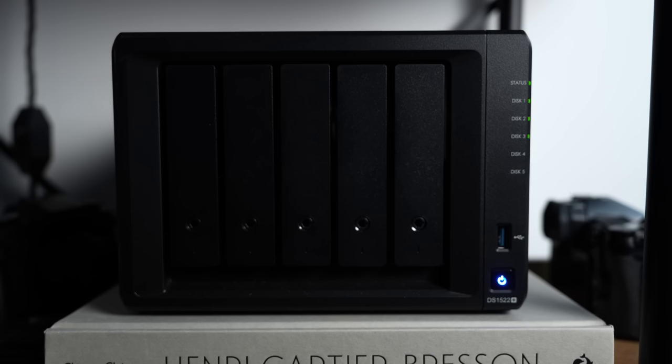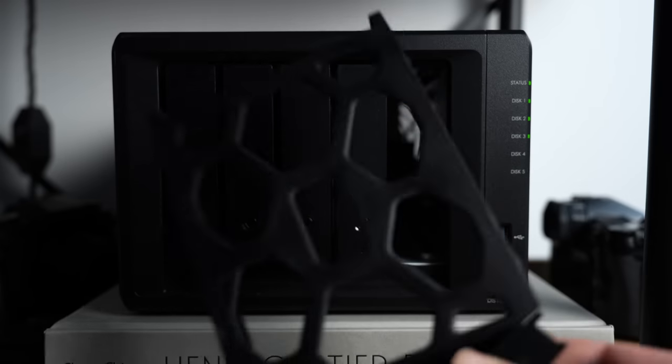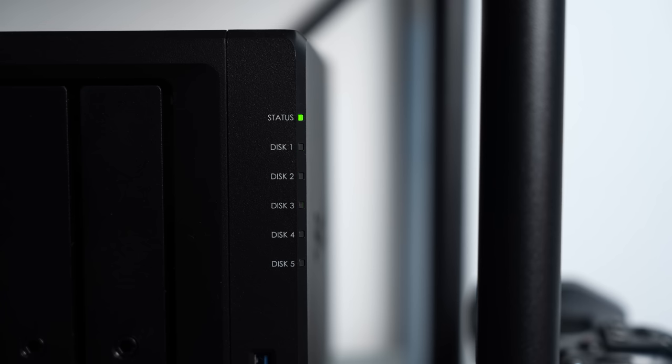The second thing that's really good about this is that there is redundancy built into a NAS setup. This is a five-bay system and I currently have three hard drives in it, so two bays are empty. The concept of RAID scares me a little bit, but basically here's my setup: if one of my hard drives fails — and it will fail, all hard drives fail, it's a case of when not if — it's not the end of the world. There's enough data on the other two hard drives to rebuild the data onto a new hard drive when I put it in.